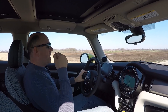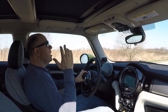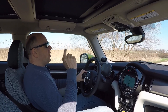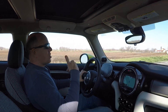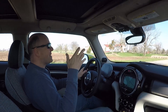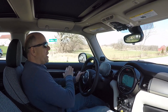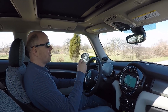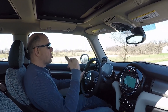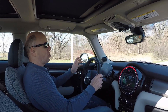A lot of people like to pull their car in, plug it in overnight, ignore it, let it charge all the way up, and in the morning unplug it and go to work. But charging to 100% daily is actually not good on most EVs. With the Tesla, you can set the charge limit on the screen — I stop my charge point at 80% daily, sometimes 90%. For our other two EVs, both the Mini and the Smart, you can't program in a stop time, nor is there an app to start or stop charging like the Tesla. So I manually go out and unplug the two short-range EVs at the charge point I want them to be at. I always have in mind how long I want each car plugged in.